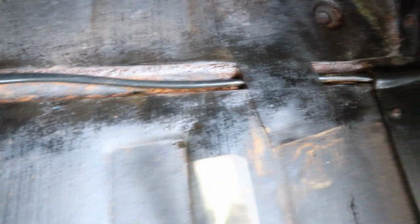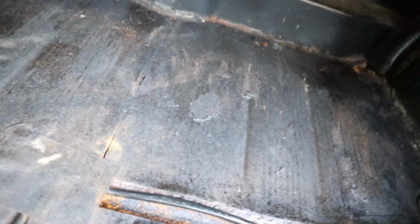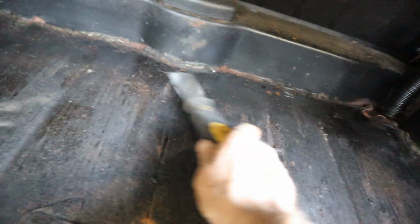There's a little surface rust here and on this side of this support beam here, but generally this is completely serviceable. On the other side, we do have a little bit of rot at this support beam. Someone's tried to do some kind of repair here, but the floor is really solid, so that's a bonus. We've got a little bit of surface rust coming in on these corners, nothing that's taken real deep hold, and also just a little bit in that wire channel. I've treated it with the acid etch just to arrest it, and a little bit at the back corner there and here.